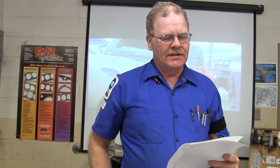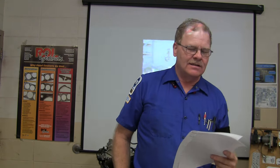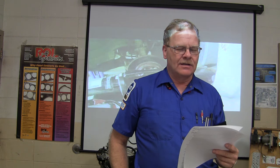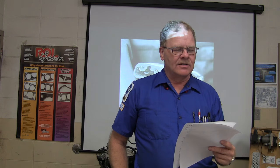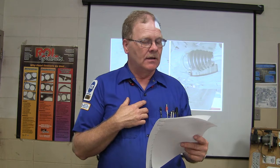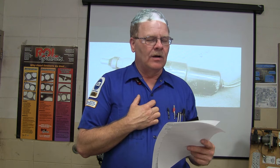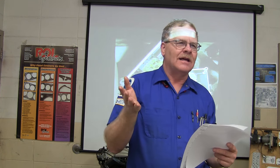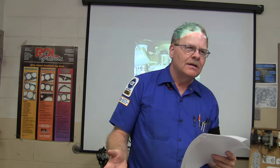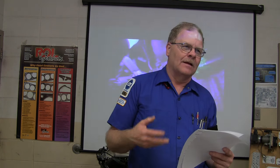Okay, now then, the customer complains the heater works sometimes, but only cold air comes out while driving. Technician A says the AC system may not have enough refrigerant in the system. Technician B says the cooling system could be low on coolant. Who's right about that? What are you going to tell them? I'd say technician B. Will the AC refrigerant keep the heater from working? I don't think so. Have you ever seen it low on coolant and keep the heater from working?